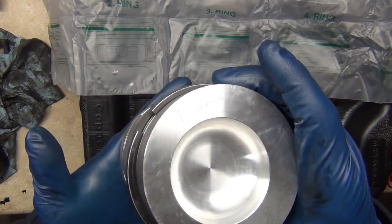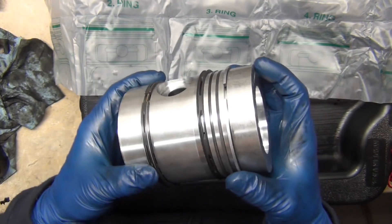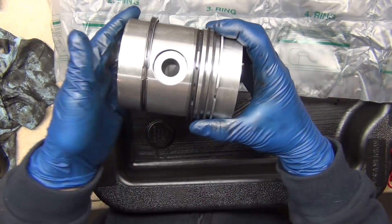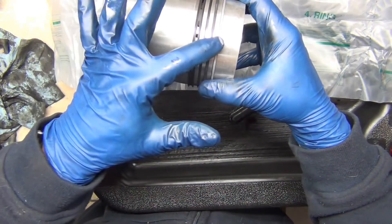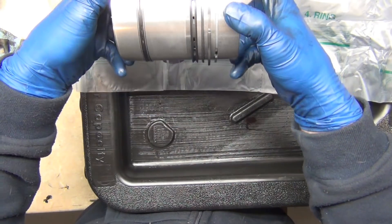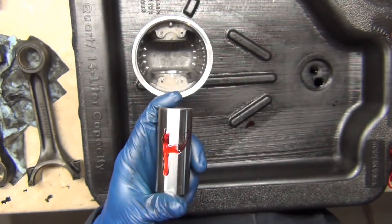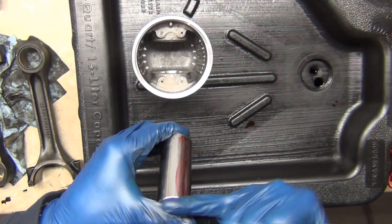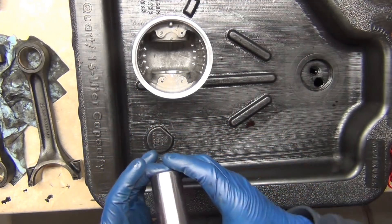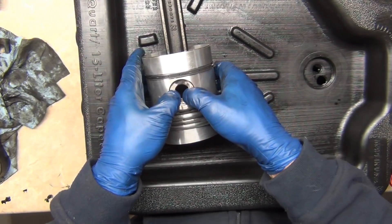When you're shoving the exhaust out, all the rings go to the bottom. These have a special name — it's called a landing, a piston ring landing. You can hear them wiggle just a little bit. Check your gaps — I don't see where these two line up, so I'll rotate that a little bit so nothing lines up with anything else. Get some assembly lube because it's going to take a while for oil to get in here. Get a bunch of it and just work it all around — if you get it all over the piston you're generally pretty good.